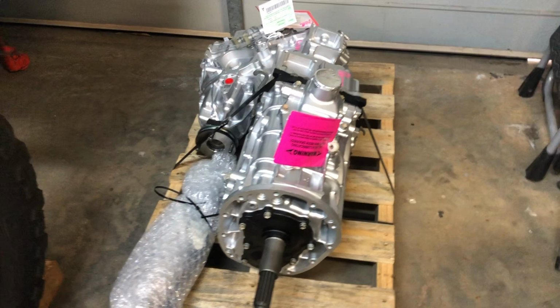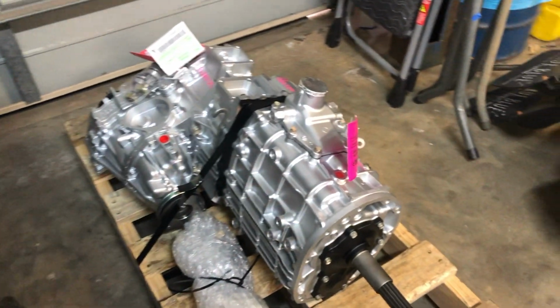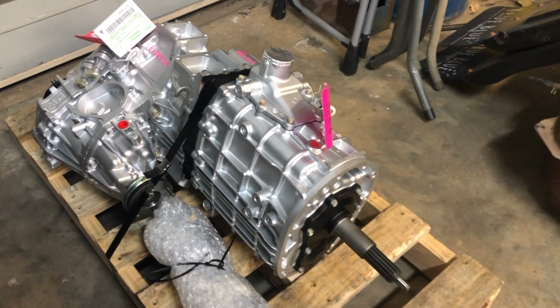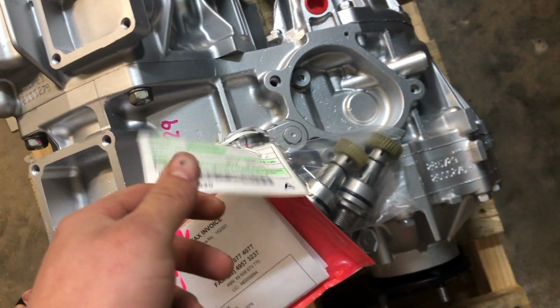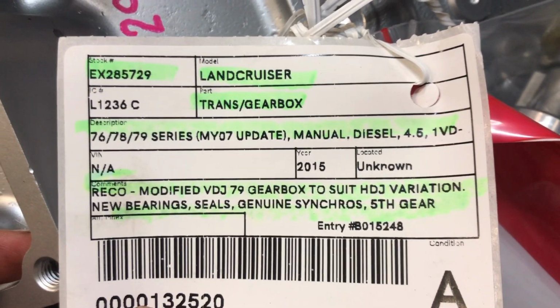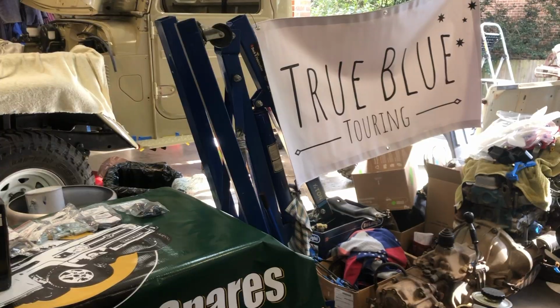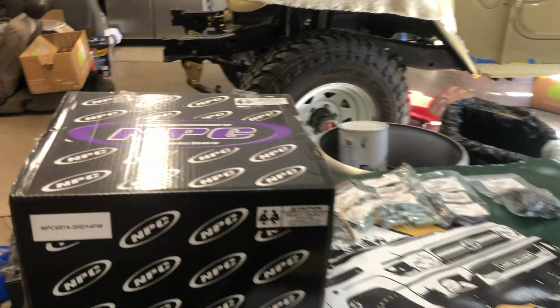We went with an H150 gearbox which had been fully rebuilt with genuine synchros, bearings and seals, with a modified coarse input shaft to suit the motor, as well as hosting Terrain Tamer's taller fifth gear modification. The transfer case was a fully rebuilt HF1A unit from All 4, which is a part-time transfer, allowing me to run freewheeling hubs on the front.